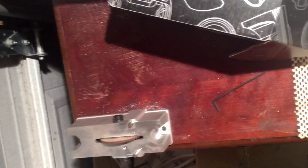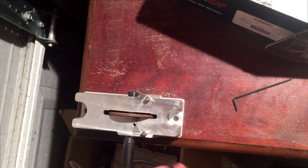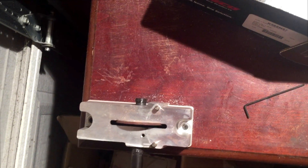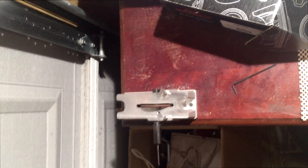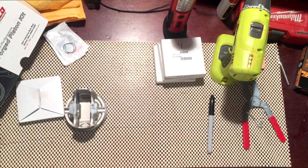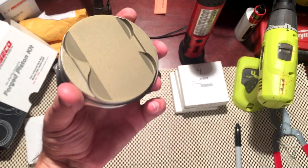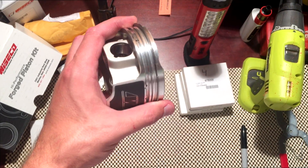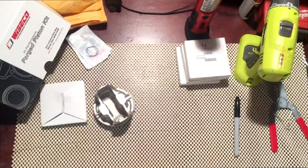Well, that took forever. As you can see, it looks like I took a good chunk out of the piston ring grinder there. I don't know what the deal is with all that play, but I grinded it away. This thing's a piece of junk — I wouldn't recommend buying the cheapest piston ring filer you can buy. I think it took maybe a total of four hours to grind all the piston rings down. That was a pain. I've already got one piston ring on because I was using that to make sure I lined up when I was measuring the end gap. I'm going to put the other piston rings on and label the pistons.